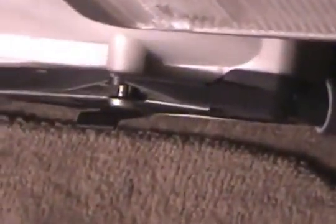One more thing. The screws in the back are real hard to get to. Well, not real hard to get to, but you can't see them very easily. Put the front screws in first. That will guarantee alignment on the back screws. That's it. 4 screws are returned to their place. Everything is securely fastened, so we'll put the outer cover back on and be done with this thing.